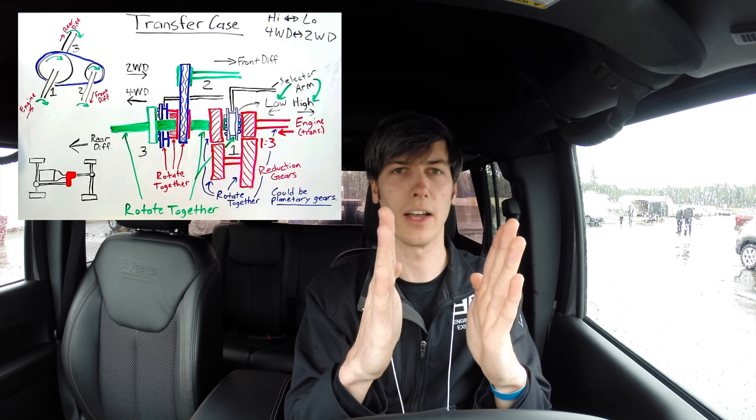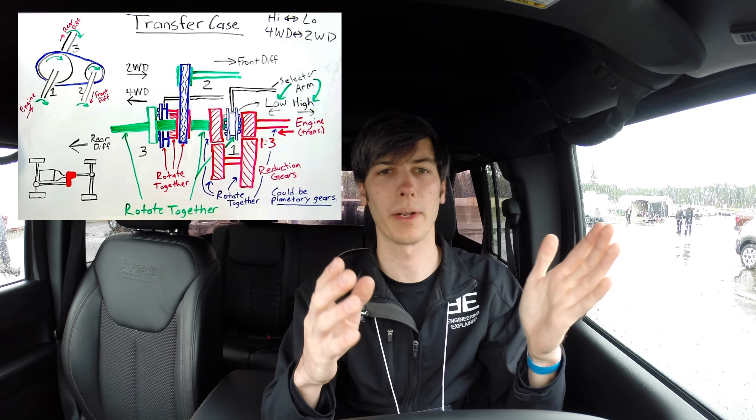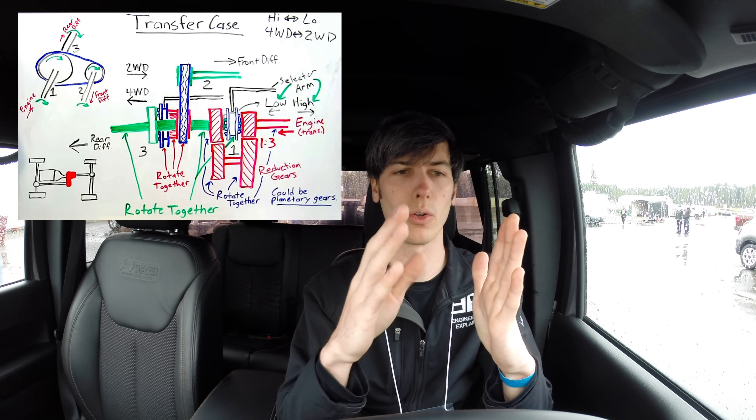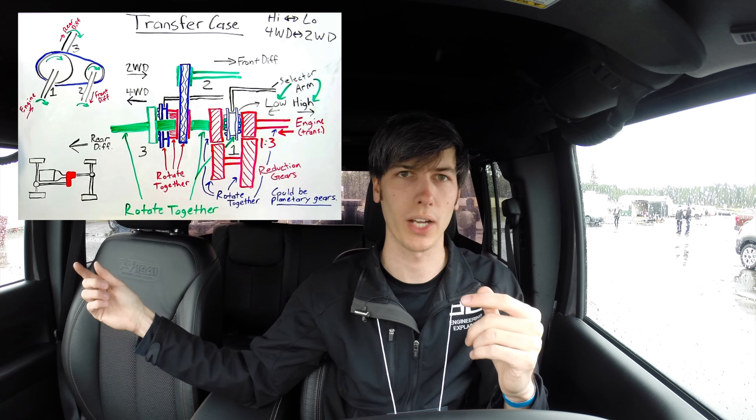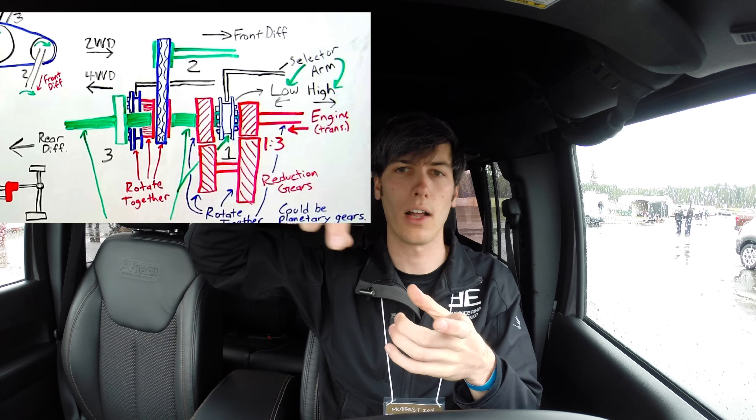If you're at a little bit of speed with the transmission in neutral, you can mesh the gears and spin up the transmission shaft — that's why some vehicles allow it up to two to three miles per hour. But essentially, best practice is to come to a stop, put it in neutral, and switch it over. It works very similar to a manual transmission with a collar that pops out of the high gear range and into the low gear range.